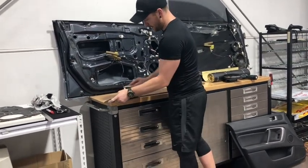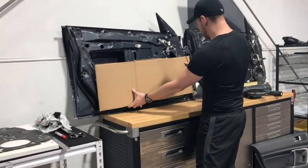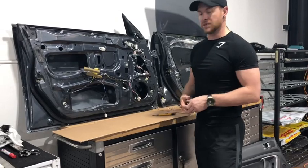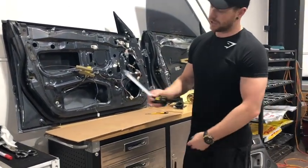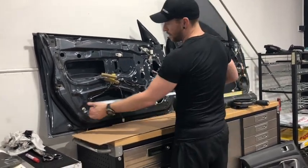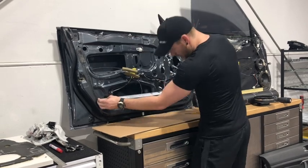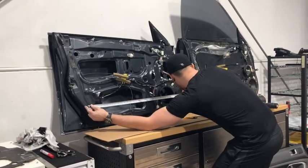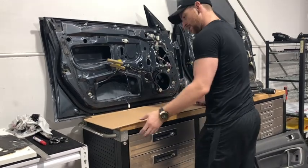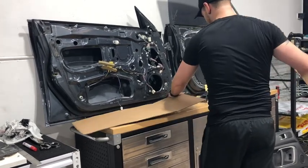Use a ruler if you're fussy. We're going to do this bottom section. From here, I find it very easy to use rulers and measurements as a guide to how big your template is going to be, because you can always subtract and add to your template at any stage since it's just cardboard. I'm going to measure how wide it's going to be - from here out to here, following where the bar sits. It's going to be 830mm. We're just about the right size - probably a little bit too long, so I'm going to cut 30mm off this side.